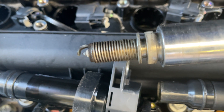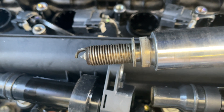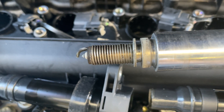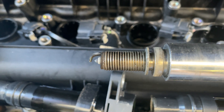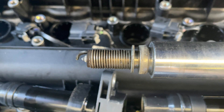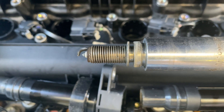You can see down there we've got the very fine tip and I'll check the measurements. These plugs weren't changed long ago so the plugs are going to be fine. I'd say it's just the moisture around the end of the spark plug that's shorted from the coil to the engine head and caused a misfire. It was good to find the water around cylinder two especially because that's where the misfire was. If you've washed your engine down or had any water around the engine, there can be water down in the ports and it can short out.